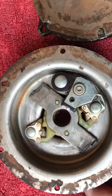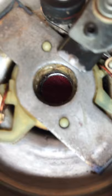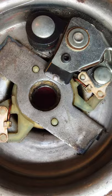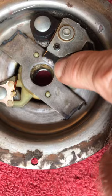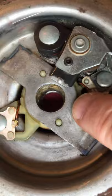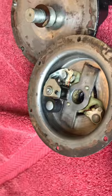That plate has to vibrate courtesy of an electromagnet, which sits in the top here with connections either side. It relies on that shaft going up and down. Mine was full of grit and I hadn't realised, so I connected it up to the battery again and tried to shake it loose — and in the process, keeping the power on, I managed to melt the innards. So: tip one, do not grit blast; tip two, do not put WD-40 in; tip three, do not leave it connected to the power. Because if that shaft is blocked and doesn't move to cut off the power at the contact point, you will burn it out.